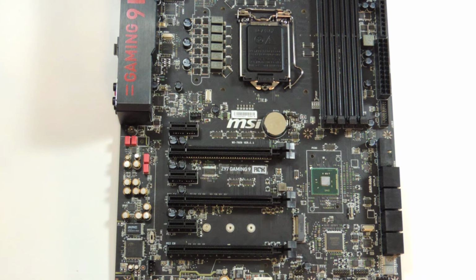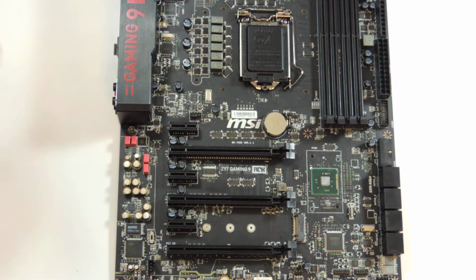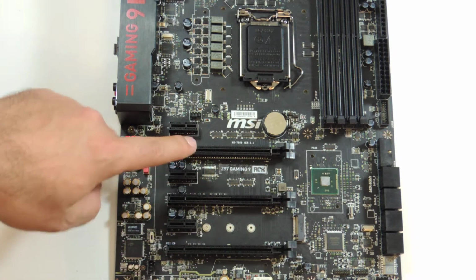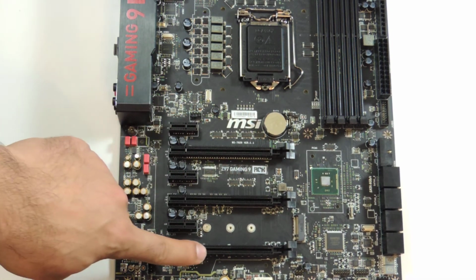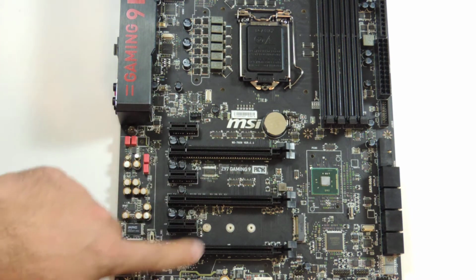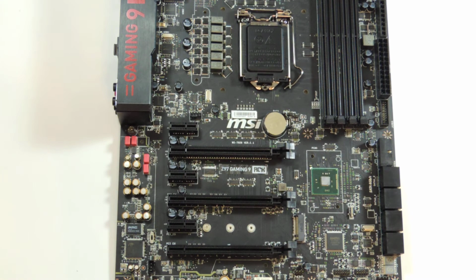If you want to see a diagram, I don't think I explained it that well, but you can see a diagram on the side. Or really, this is the standard Intel PCIe allotment. Nothing special about it, but that's how it works. 16, 8, 4 hardwire. Then you go 16x 0, 0, 8x 8x 0, or 8, 4, 4. Okay. So this 4x switches this 4 over here, or here, or here. Well, because of how it's done, just between here and here, and this switches this 4x between here and here. Okay, a little confusing, doesn't matter. I just confused the heck out of you before I ended the video.